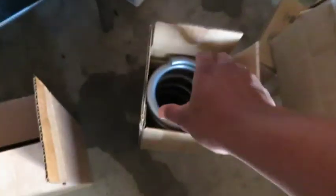Here's the coil. It comes with some thrust bearings, and these basically just screw into the bottom portion of the tubular control arms. And these are the coils. Now these are 500-pound coils. I think if you do your research about the Firebird, the average weight that these coils are going to support is going to be 450 pounds.